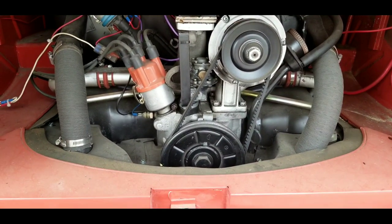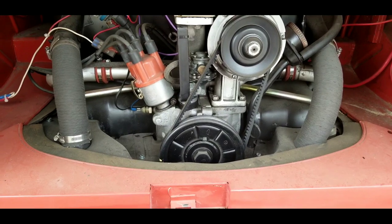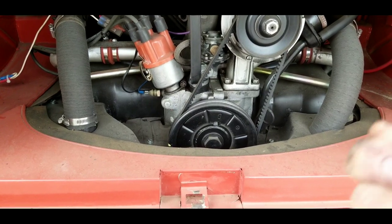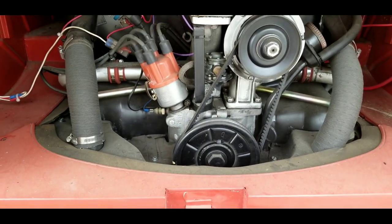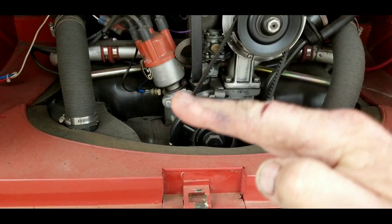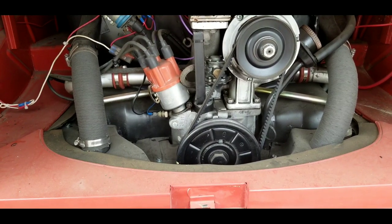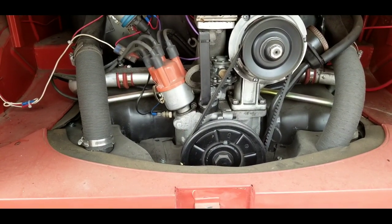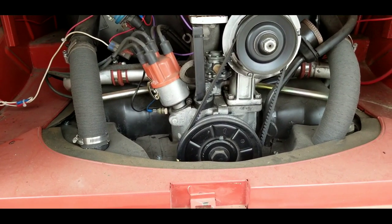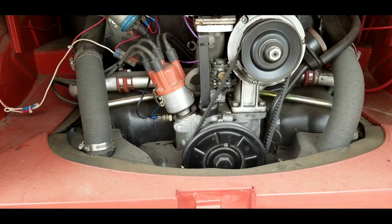You don't know how many engines I've actually replaced because one of these fuel pumps leaked gas into the oil and wiped out the bearings. So pull it out, smell it, make sure it does not smell like fuel, and watch for the oil level going up. What it'll do is go up for a little while, and then all of a sudden start to go down really quickly because it'll wash through the rings. You could also get a little gas in your oil from a car that doesn't have thermostats — if you're starting up cold a lot and not letting it warm up properly.